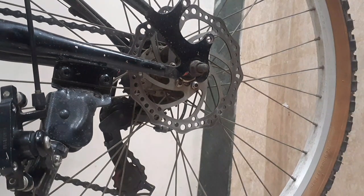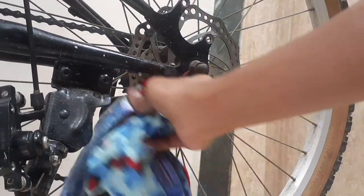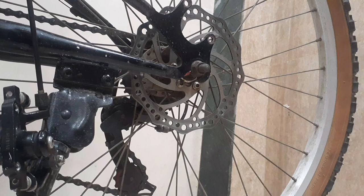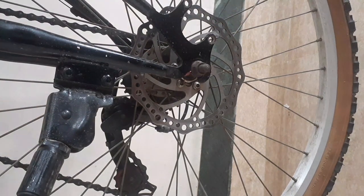It's so dark from this point — we know how much oil was on our disc plate. After completing this, we take a cloth and clean the disc plate. Remember: we should never put the disc plate back if it has oil on it — you will damage the disc. So remember this.